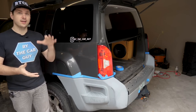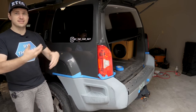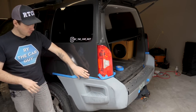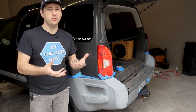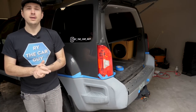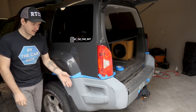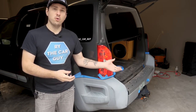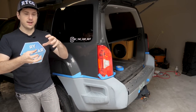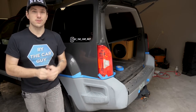Now that the grill looks good, it's dry and the emblem's on. I'm going to focus on painting the rest of the plastics. I already have a video for this. Here's what I'm doing differently this time: I'm not going to remove any plastics from the car. I'll just mask everything and paint it in place. The only things I popped off were the grill and the step panel off the back bumper — which just lifts with your fingers, so why not? I also pulled off exposed bolts so they won't get painted over lazily. Then we'll go install the front-facing camera.